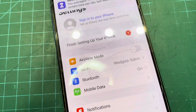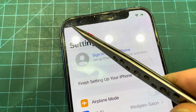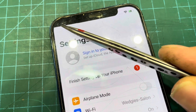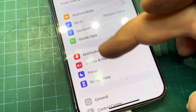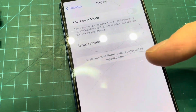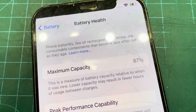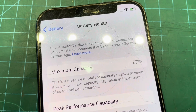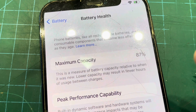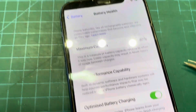Unfortunately I've got to replace the screen because of that black bit there - that's what the battery swelling has done and it's just broke that top bit. Anyway, what we're most interested in right now is the battery. The battery health - and that's at 87%. So I'm going to put an external battery flex on there and read it and get that up to 100% because I've just put a brand new battery in it, so that should say 100%.